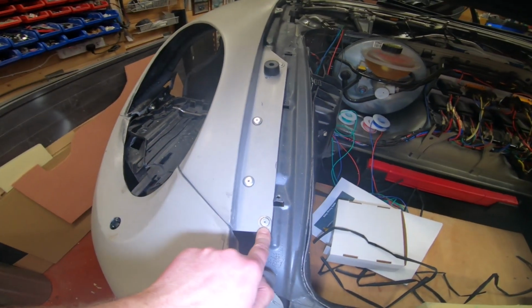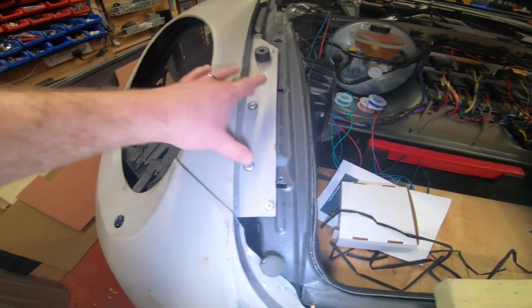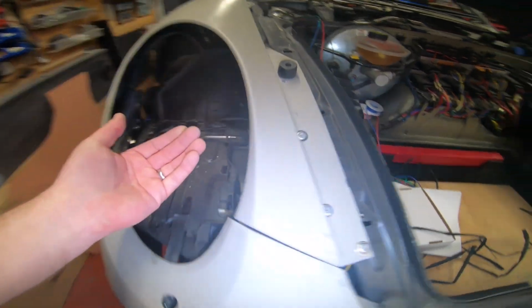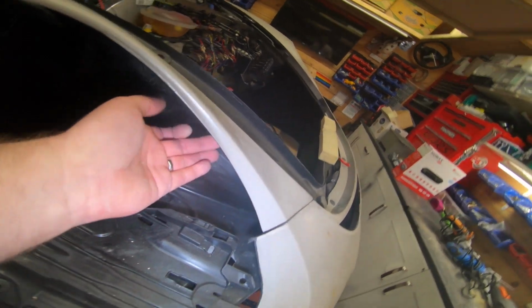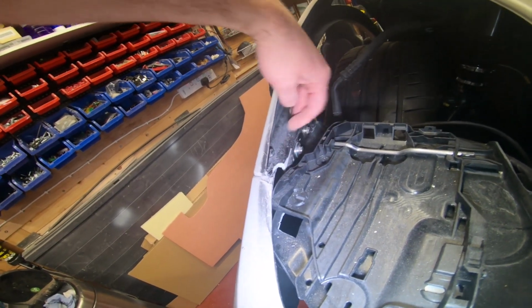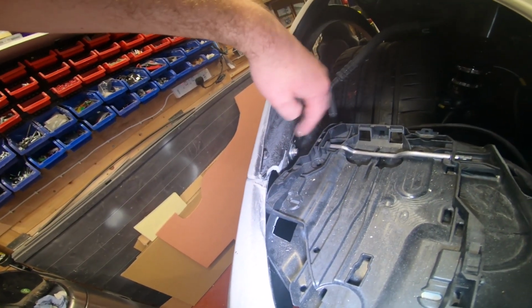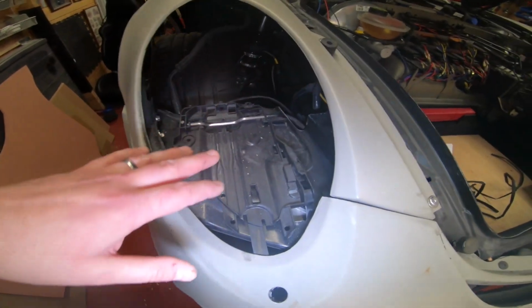But if you look at these rivets, that rivet there and that rivet there attach the wing. These two rivets are the underside of the headlight tray, yeah? And you can see how this headlight tray is bonded, affixed, to that. And then the headlight tray bolts to this inner flitch, this return that's on the wing, all right? So again, you can worry about them afterwards, really.